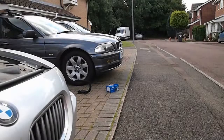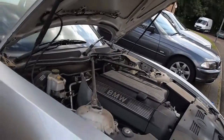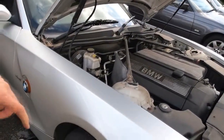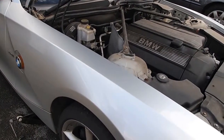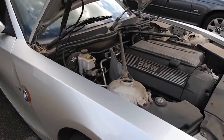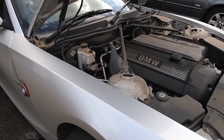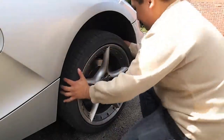I'll let Adam do the explaining because I tried to do a voiceover and failed many, many times. Basically, you open it. Because when you push the piston back in the caliper to free up space, it pushes all the fluid back into there. And you don't want that with all the air in there as well. You want there to be no pressure so that it can raise the level rather than not go anywhere. Right, with that explanation out of the way, take off the wheel you'll be working the brakes on.